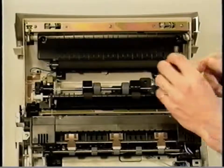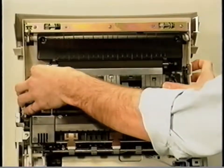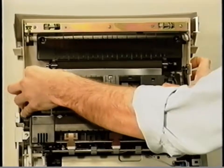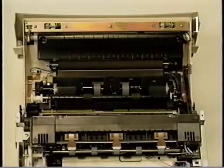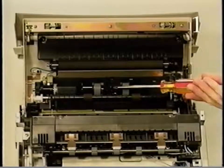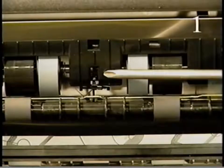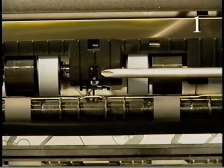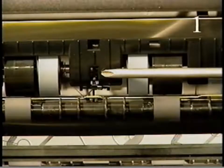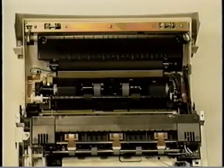Here is the paper charge deflector. This deflector removes any charge on the paper before it passes the transfer roller. The registration sensor and sensor arm are located on the paper charge deflector. When activated by the sensor arm, this sensor determines when paper is fed into the printer and sends a signal to the DC controller, which initiates the scanning of the image onto the photosensitive drum. This concludes Part 1, Parts and Functions Print Cycle Initiation.